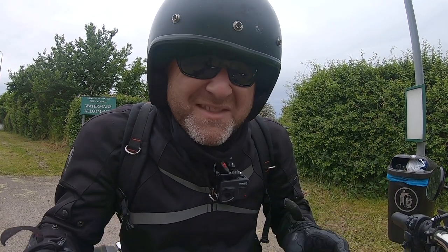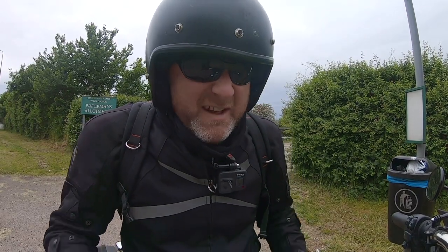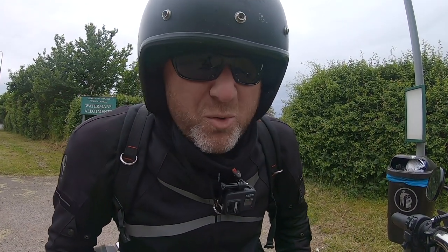The problem that I've got with these tyres, even as brand new, there isn't a tread pattern in the centre of the tyre. So it's actually quite hard to look at it at first glance and say I need a new set of tyres, because they look bald brand new.